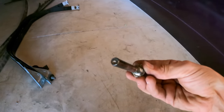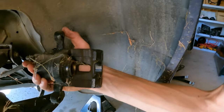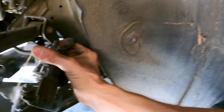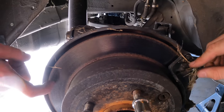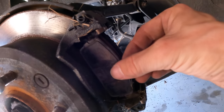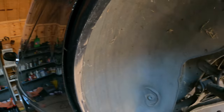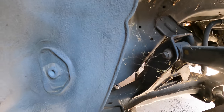Looks like there's a bigger pin on the bottom and a smaller pin on the top. Well, not always — Nissans in particular have different calipers from what I'm used to seeing. Usually they have the e-brake built in, but these are separate, kind of like the 300ZX. These look the same as Pathfinder calipers. These pads are way too small to be on a Pathfinder. Z brake conversion coming in soon. Before I proceed any further I'm going to vacuum out all these spider webs in here.